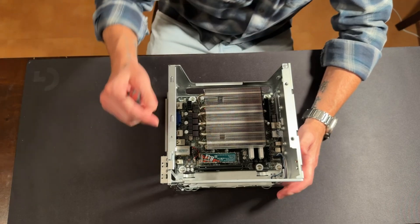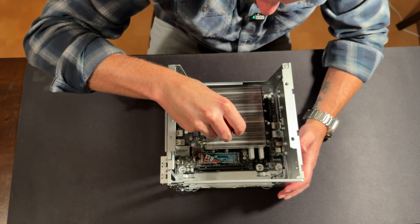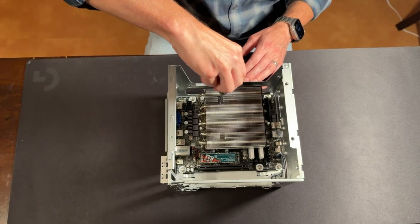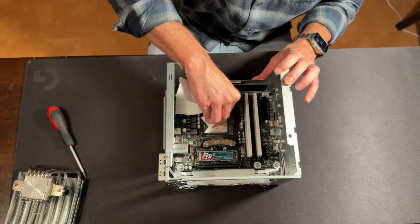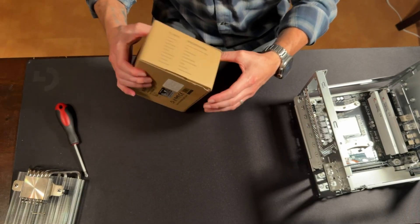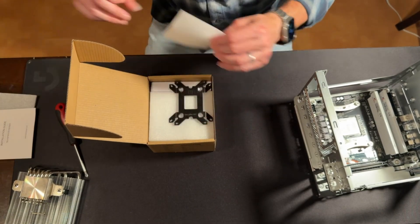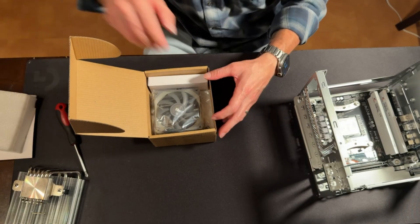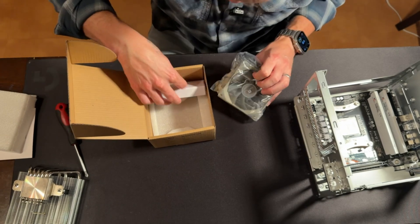That seemed like a few seconds, but that was actually two days. I had to get a new cooler — I also had a final exam in one class and a presentation in another. Let's go ahead and pop this old cooler off and apply some fresh thermal paste. We have an AXP 90-36. I actually wanted to use the 42 or 46, but I would have had to order it and didn't want to wait. We'll check the temps with this — it should be good, and if not I'll switch it out later. This is much, much smaller.